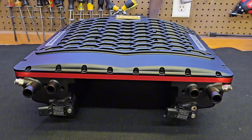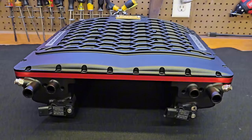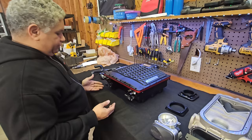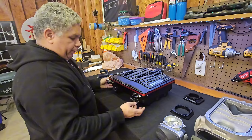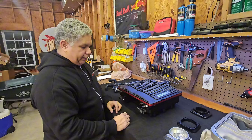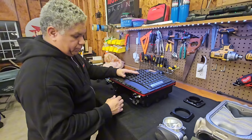One of the key elements of this design is to take advantage of every square millimeter — basically a slice of paper — of the space available in that engine bay. We had to clear sensors in the corners, clear castings in the engine heads, clear all various objects, and allow for custom map sensors. It was a challenge, but after many variations and a lot of hard work from our CAD designer and engineer on this project, we made it happen. Everything bolts right on and everything clears — you don't need to modify your car.